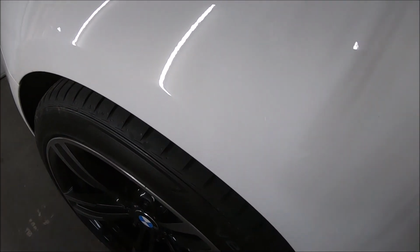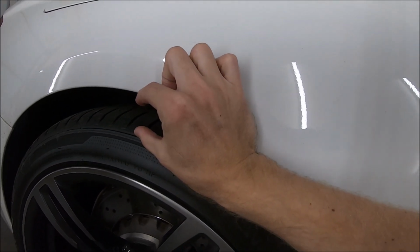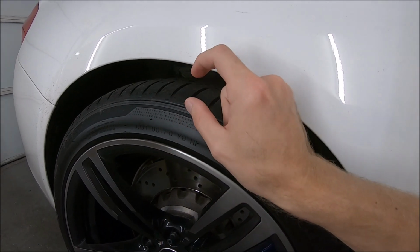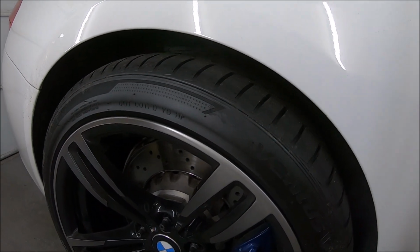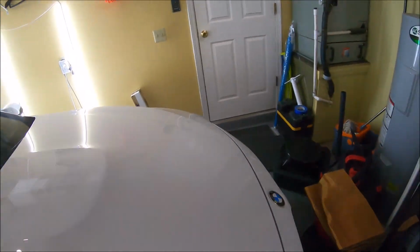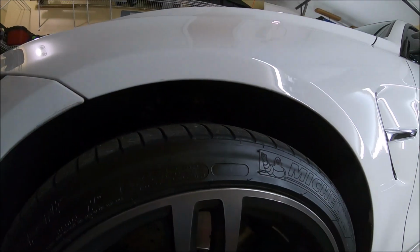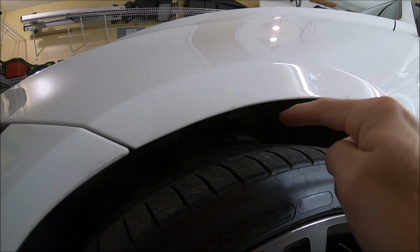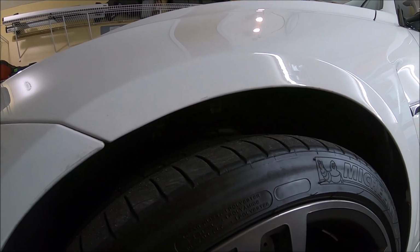And now all we need to do is just draw this gap down. We're gonna come down about 1 inch here, which I measured out, and 1 inch is gonna be absolutely perfect. We'll still have some clearance, but it'll be starting to look tucked in there. And then 1.3 inches on the front is getting to the point where it's pretty drastic, but that's also been measured. There's way more wheel gap in the front than the rear, so this will come down 1.3 and we'll still have probably a finger to be able to put in there once it's lowered.